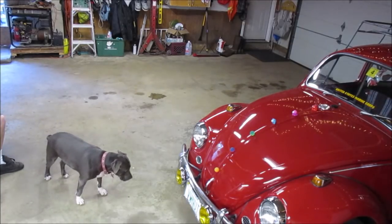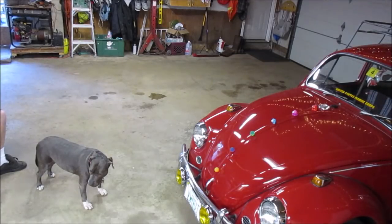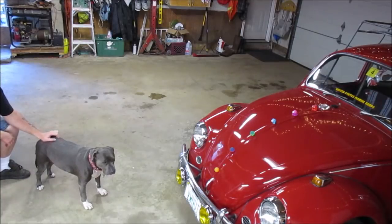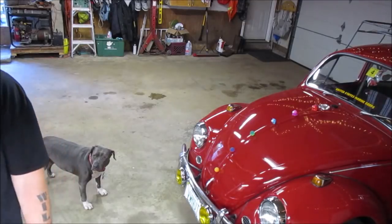I drive this car a lot this time of year and I'm pretty particular about the way it runs. Right now it's not running up to my standards. Today we're going to start by taking the carburetor off and seeing what kind of junk is in it. I was talking to my friend Musty One, and he said I should add a washer to the needle and seat because it sounded like maybe it was flooding over a little bit. We'll check all the jets and things and get going from there. First things first, I've got to turn the car around so I can get to the back of it.